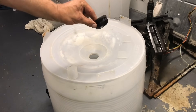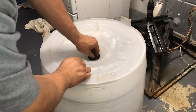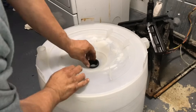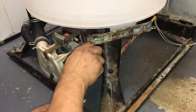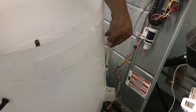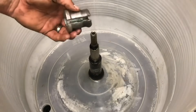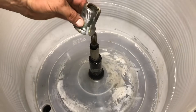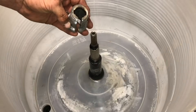Here's the brand new main tub seal — that's going to fit right down in here and you'll feel it click into place. You've got to work at it a little bit. Next up is to install your spring brackets — there are three of them — quarter-inch bolt. Make sure you reattach all four springs, then connect your drain hose and reattach the hose that detects the water level. Next up is the drive block. I cleaned it up with a bench grinder and wire brush wheel because it was so filthy and corroded.